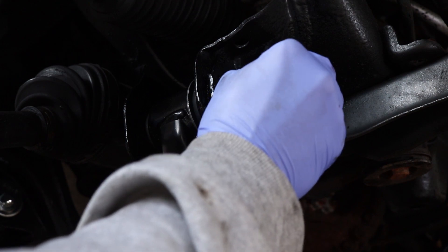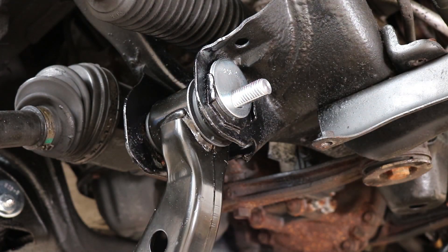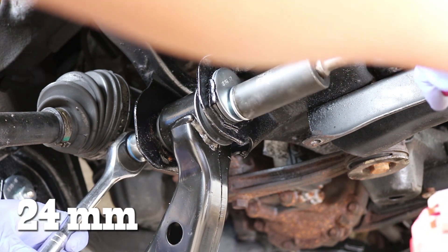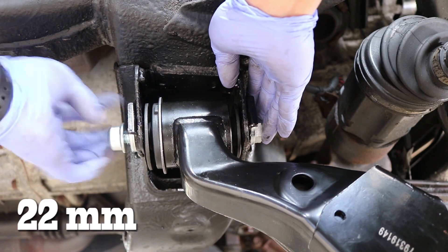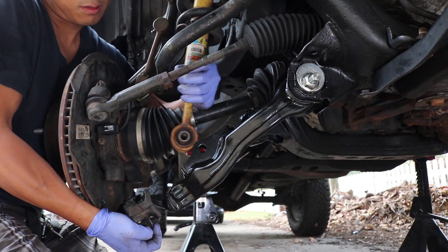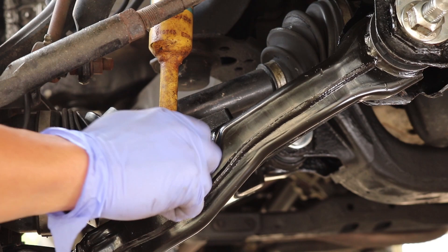Install the sleeve at the front — you may have to tap that lower control arm to line up the holes. Install the bolt outwards. Now we can also install the cam and install the lock nut. Use two 24mm sockets at the front to further drive down the lock nut, but keep everything loose for now. Use a 22mm and a 21mm socket at the rear to drive down that nut as well. Pull up on the lower control arm and line up the holes with the lower shock mount to install the bolt, washer, and nut. Finger tighten that for now.